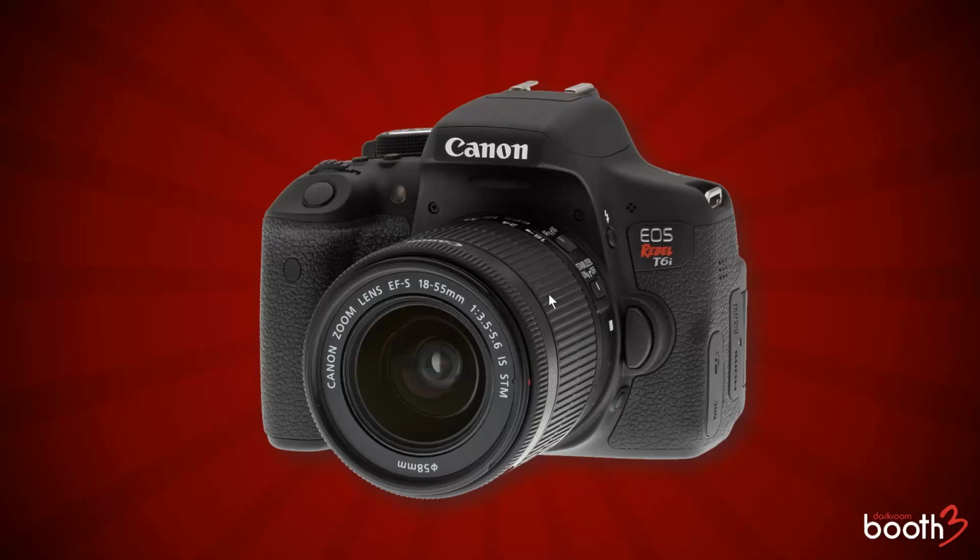Then if you look right here on the side of the lens, there are two switches in this particular case. Some lenses only have a single switch, but most all cameras have an autofocus switch. This one right there is the autofocus, and it'll just simply say A or M. It may say AF or M, but that's autofocus versus manual focus on the lens. This switch down here is a stabilizer in this particular lens. Not all lenses have that, but this one does. Since you're having it stationary and mounted in a photo booth, you can usually set that to off.